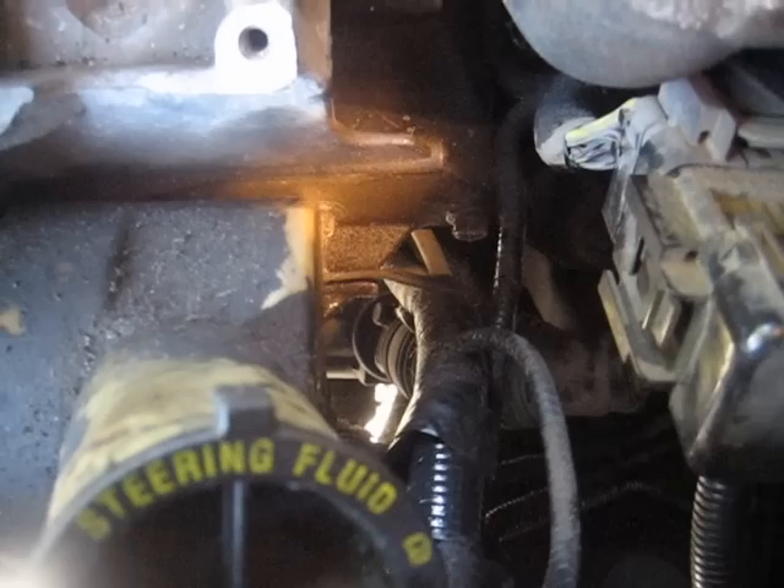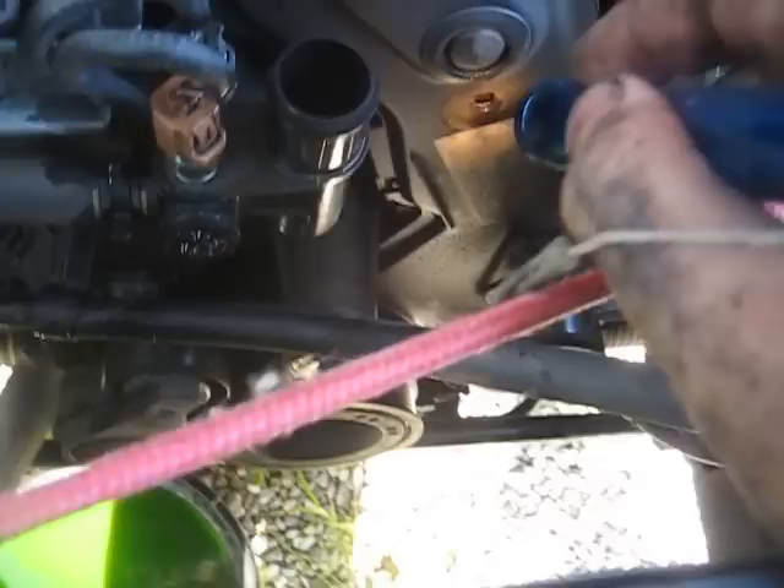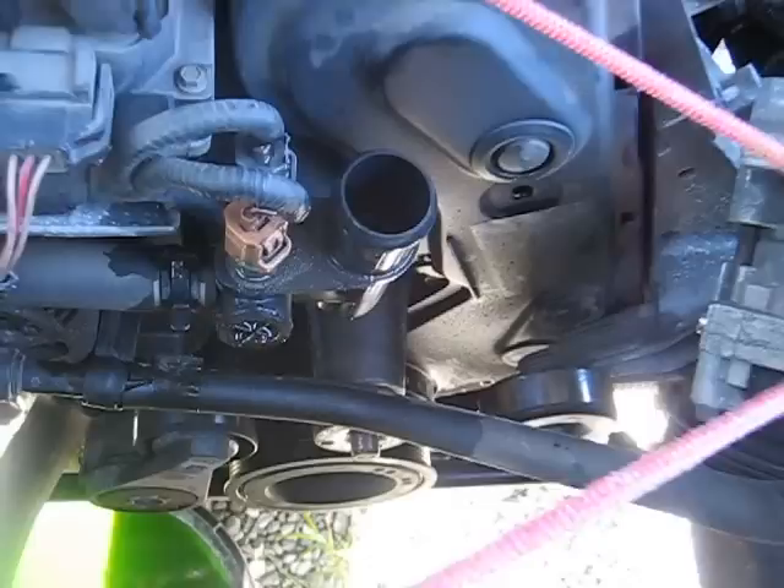So what I'll do next is take my wrench back in there and break that loose. There's that 13 millimeter right there and then this bracketry can come back out. When you get the bracketry out, it will free up the front of this belt cover. This belt cover's got mainly plastic tabs holding it down. There's one bolt down in the bottom that's a 10 millimeter, and there's a bolt that goes in that hole that's an 8 millimeter. I use the 5/16ths. Then this front cover should come off.